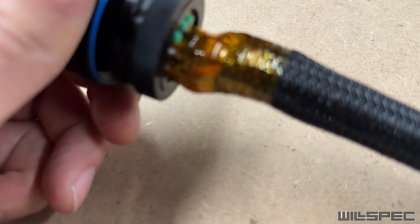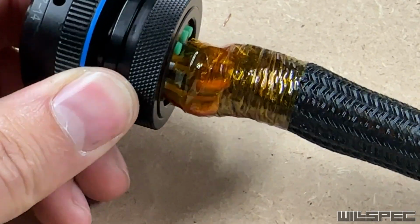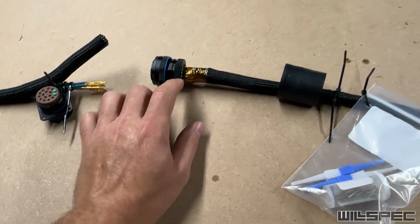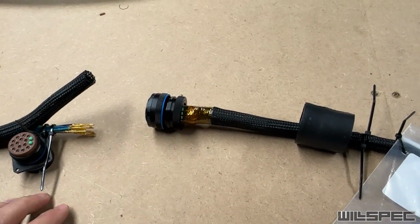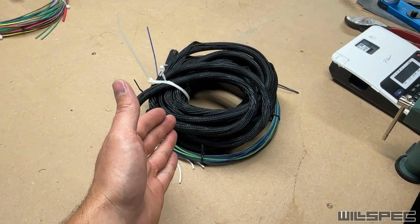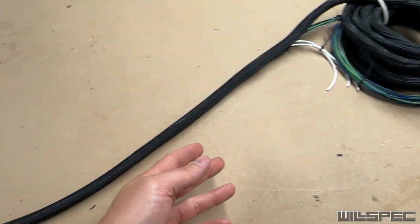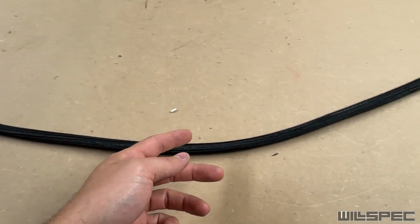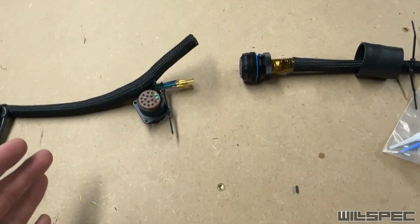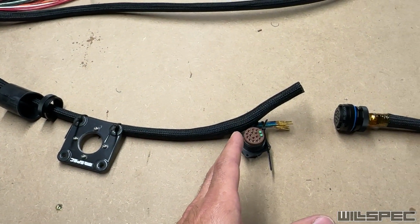Now in here, the other side will be the same, but it's tough to see. Maybe I can zoom in a little bit. There are service loops in these wires, and you'll see me do that on the other side. The wire actually comes out, does a loop, and then continues on, and what that allows you to do is if you ever need to get in here to make a repair, you have a little extra wire to work with. So this is just covered up right now with the remainder of the shrink, or the split loom, and then depending on where the breakouts are, Adam can cut this, but I didn't want to put 2 feet on there and have him need 3 and have to wrap this in electrical tape to continue on. So this turned out pretty nice. It looks really good, and when the shrink boot goes on, it'll look really good. And I think we're in a good state right now to install this side on the truck.